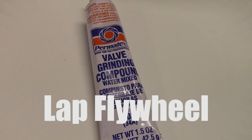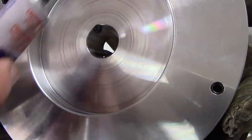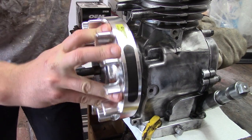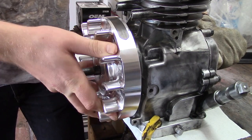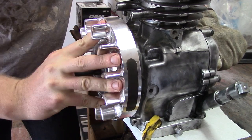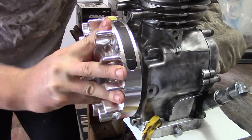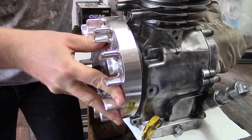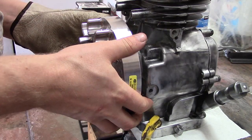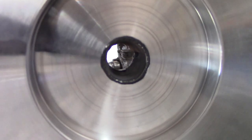You just want to pull off your old flywheel. You can use a screwdriver or a pry bar and just kind of work it off. Then you use what's called valve grinding compound to lap the flywheel to the crankshaft right where it tapers and the surfaces mate. The reason you want to do this is there might be some burrs on the keyway on the crank, but most importantly those surfaces aren't going to be a perfect match. So you're basically making a perfect mating surface for the flywheel and the crank so it'll really stick on there once you crank the nut down.